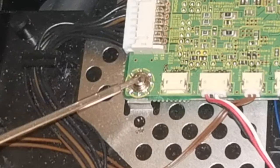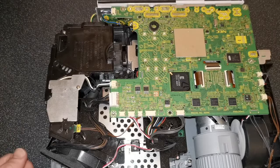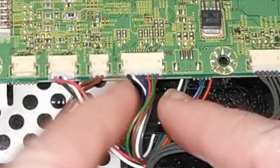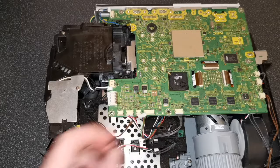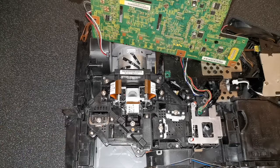With those two screws removed in the corners, there's just this one screw to remove and then we can lift the board up. The whole mount for the main PCB comes free, but I want to remove this cable, this cable, and the largest connector down here which is for the iris — just pull that out. If you can pry out the plastic connector itself rather than pulling by the wires that'd be better, as the wires are a weak point. The earth wire can get hooked, so rotate that up and that reveals the internals.